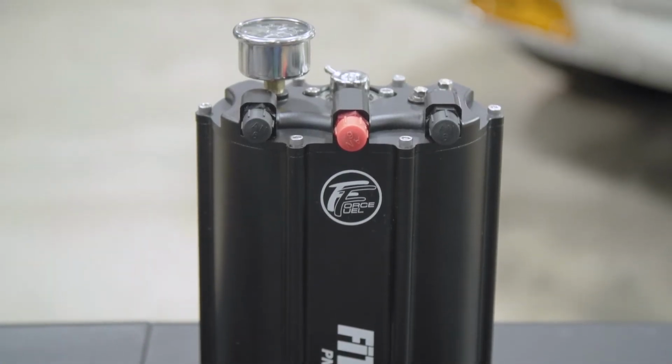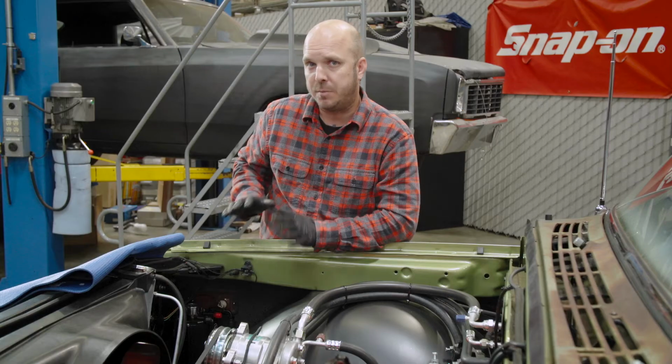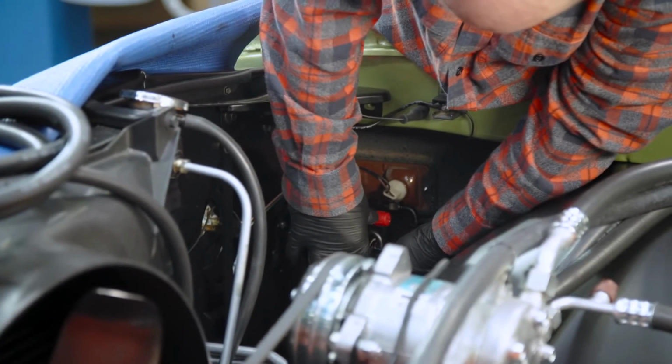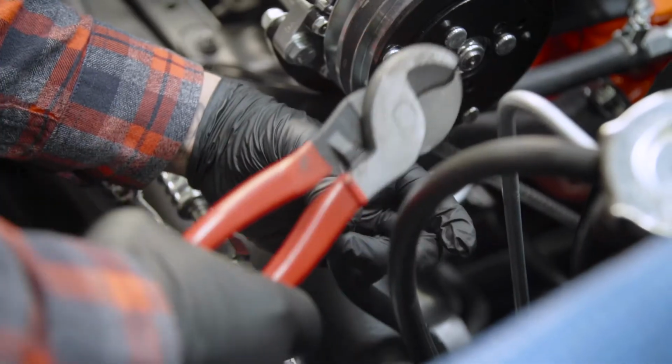But what it also does, it keeps the pump nice and cool. It keeps the pump kind of quiet so you don't hear it, as opposed to a frame-mounted inline pump. That's what all the OEs do. That's why you see them mounting the fuel pumps in the tanks, because being submerged in the fuel keeps the pump cool.